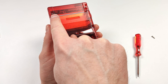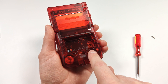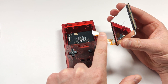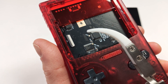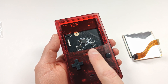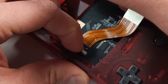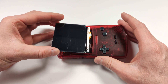Initially, before I check the screen, I'm only going to put two screws in — one in the top left corner and one in the bottom right corner. This should hold the entire unit together just while we're checking everything out to make sure it works. We can now go ahead and connect the ribbon cable to the screen itself. My ribbon cable came pre-attached to the screen, so all I have to do is connect this to the unit. If you look really closely, there is a small latch here on the motherboard. I recommend ceramic tweezers to pull this up, or you can use your fingernail. Once you've lifted that up, we can go ahead and install the screen.